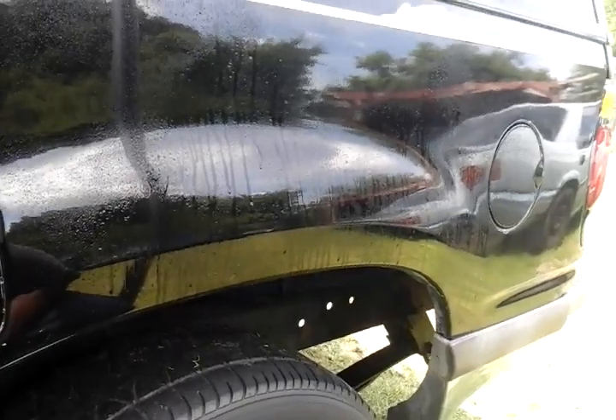If you spray it and wipe right back off, the product ain't really got time to work. Let it penetrate in the paint first — that's my opinion. Now it's had time to work. I'm gonna flip the rag and continue the wiping process. This stuff is super slick — I can feel it in my rag. That's all off now. You can see that nice shine already coming up from that slick detailer.